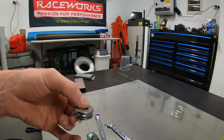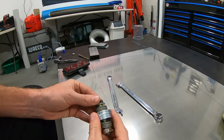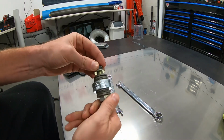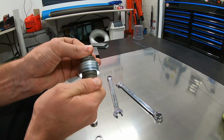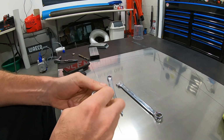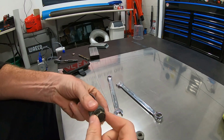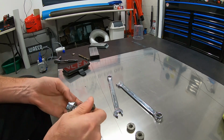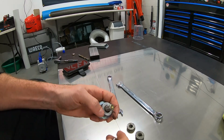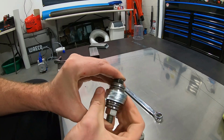I thought I'd do just a little bit of a demo to give you a bit of an understanding. This is a nut and bolt, and I've just got these washers here and here just for spacing, but they'll get replaced with this. As you all know, you clamp these down, even just finger tight, you can't turn those washers. So I'll take this out. They're all free, all loose. You replace that with one of these bearings. Tighten this down, finger tight, and that spins freely.